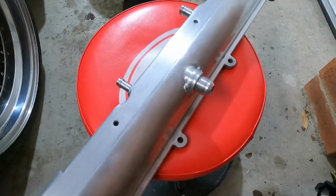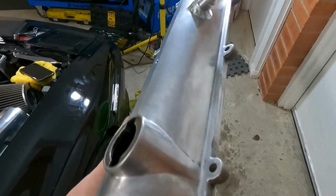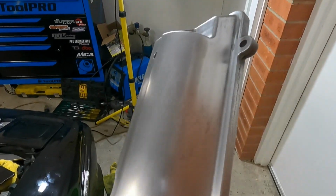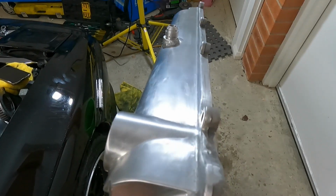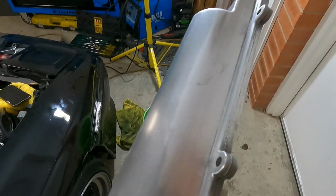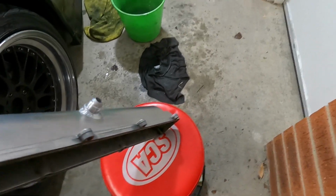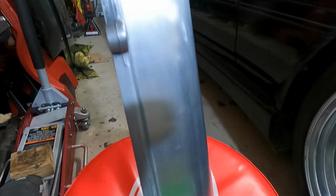We're up to the second cam cover, and I've just been sitting in the garage at night because it's quite relaxing actually, but just sanding away with all the grits, working my way up, trying to spend heaps of time on like the 240, 320, 400, now up to 600 grit I think I am. Yeah, so 600 grit. I think the more effort and time you spend on the coarser grits means that obviously the finish will be good.